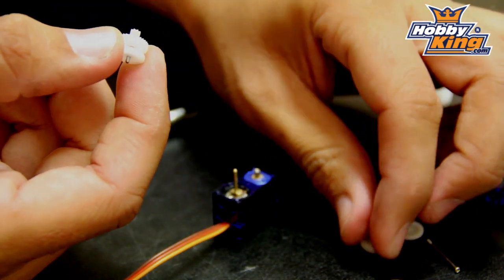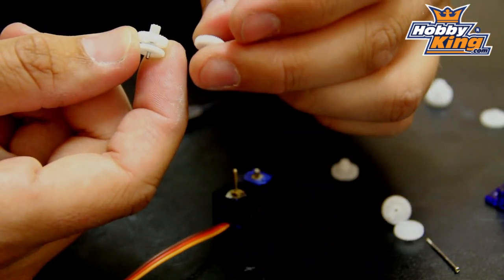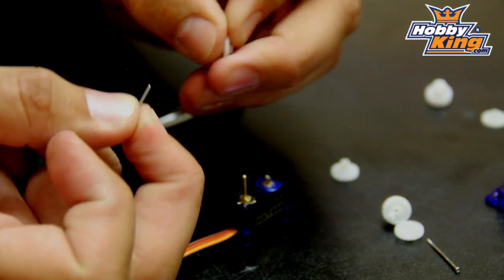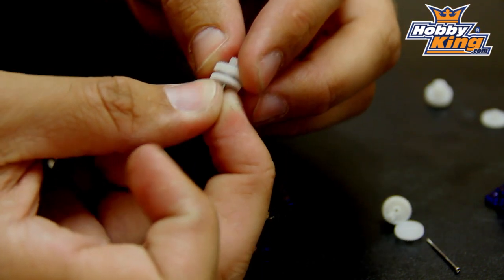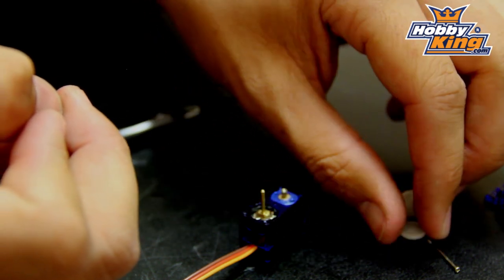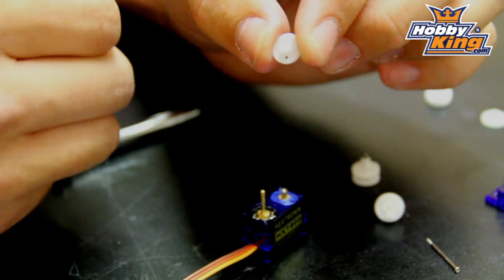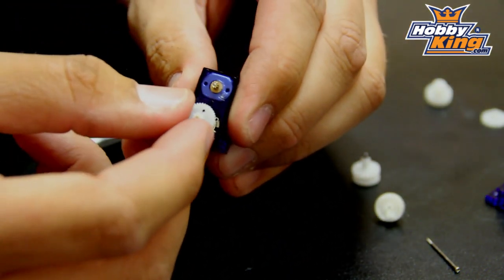You always have the one with the tall gear on top, and there's a fine mesh with a short gear on bottom. Pull the axle out, take the old gears and toss them, and put the new gears back together on the spindle. The slightly less fine-geared piece with the hole in it goes back on the main drive spindle — it doesn't matter how that goes on because it floats.